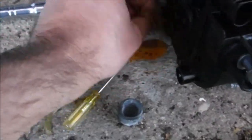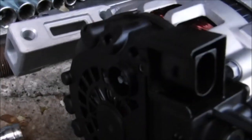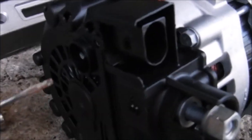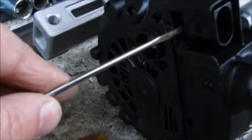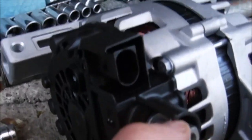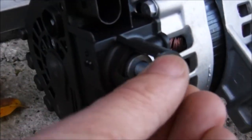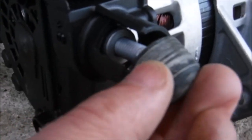From the bottom, there are two connections. There's a single wire connector — it's a little tricky to get at from the top, so you have to get to it from the bottom. You need to use a short screwdriver to pry it at this location to get past the ear. And you have the battery cable coming in here, which uses a 13 millimeter nut — it's a deeper nut — after popping off the rubber cap.